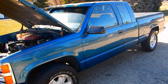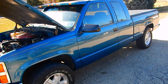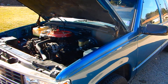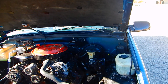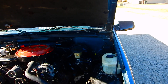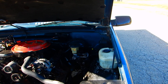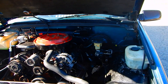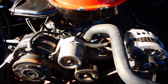Hey YouTube, I just got done fixing my truck — I actually just bought this about a month or so ago. The problem has been it only runs at about 150 to 160 degrees all the time, no matter how warm it is outside. The problem with that is it doesn't burn the fuel efficiently and it's going to cause harm to the engine, spark plugs, and stuff over time.